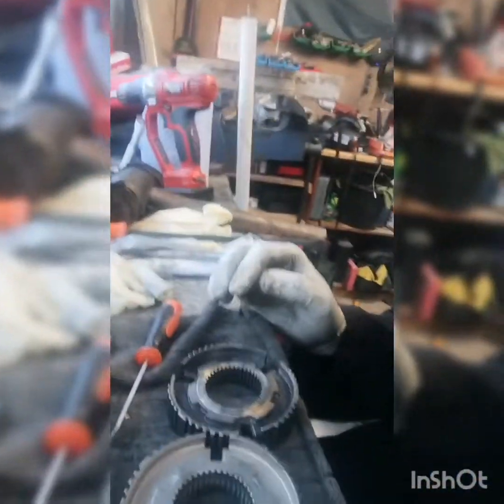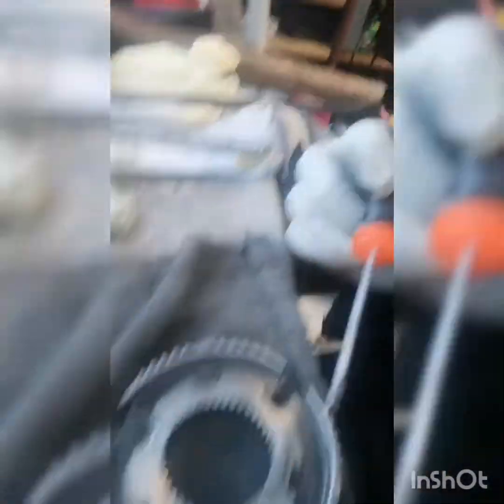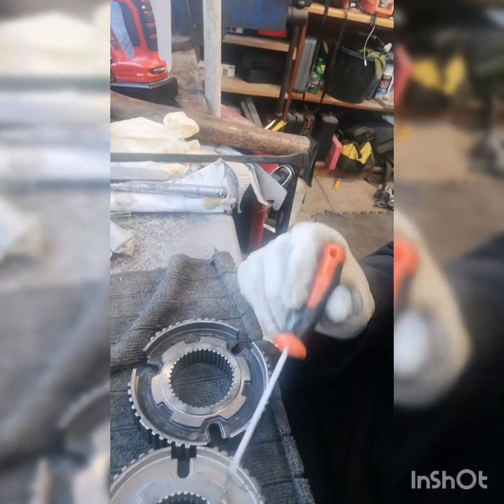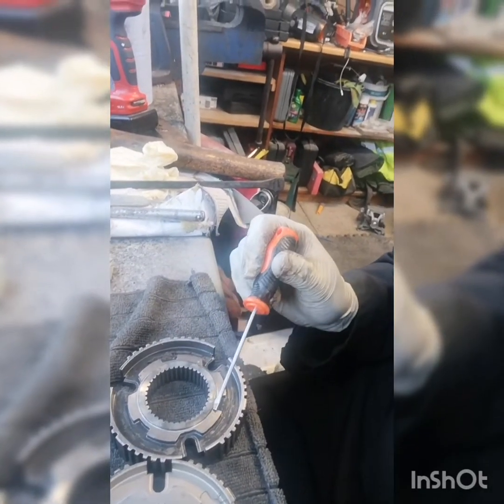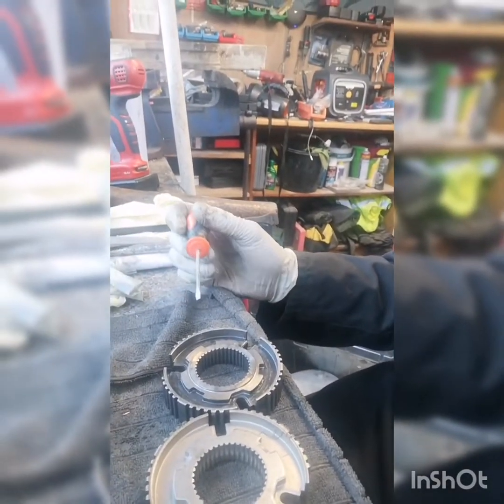This is the new one — it doesn't have a lip. Now look at the old one: this one originally looked like that, but it's been worn down so much that you've got a massive groove. That's why the second gear was going. So if you find yourself having that joystick wobble on the M32 gearbox in second gear, it could be your end case bearings, or it could be that synchro hub.